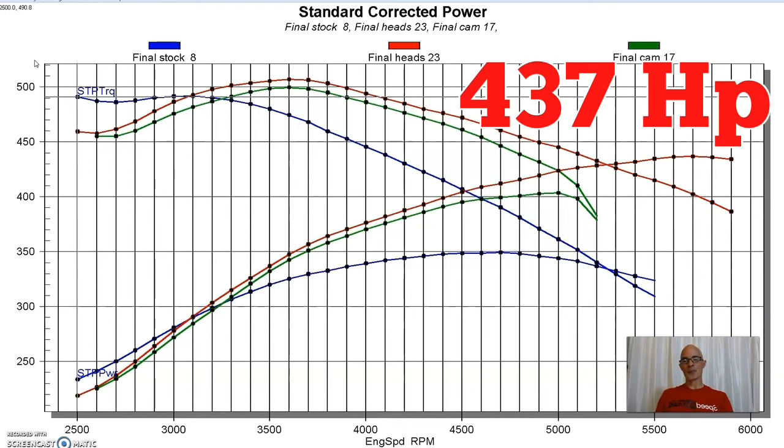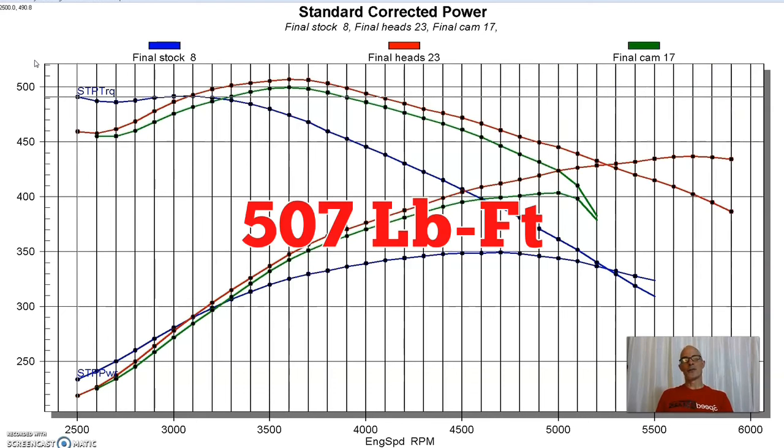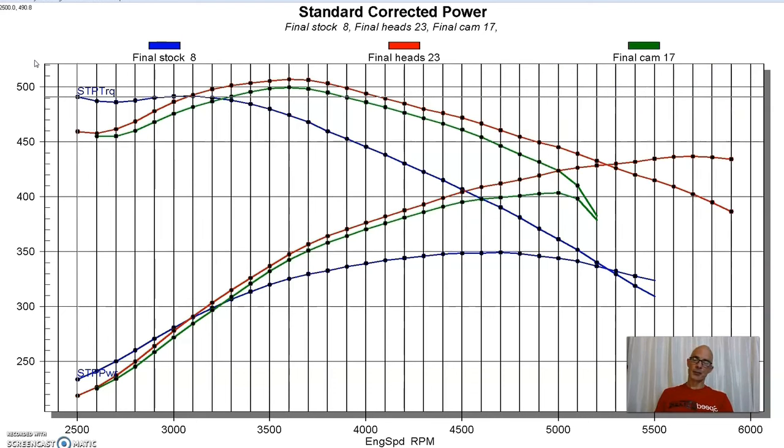And sure, it has high compression, but if you were putting together a 460 anyway, even if you started with one that was originally an EFI motor or something you're running carbureted, you would probably put a piston in it. So if you put a piston in it, just put in one that's going to raise the compression. If you do minor porting, and honestly, I don't even think you have to do the minor porting, it's going to help a little bit here.